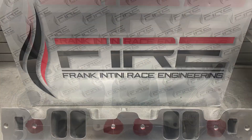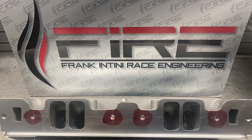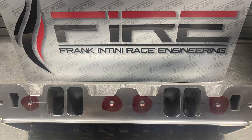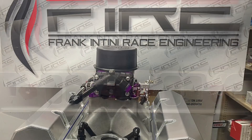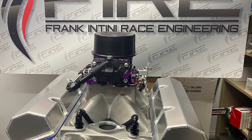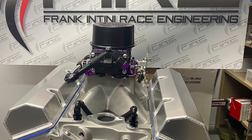It gets that water moving from the rear of the head to the front, back into the main water flow that the water pump is carrying around throughout the engine and into your radiator. As you can see in this shot, you can see the water galleries front and rear, but one's blocked off. It's a no-brainer — this is an old NASCAR trick that they did back in the day.